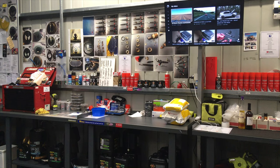Someone's sharing PID codes, okay? So that's good. I've done that also on Facebook and here and there. You've got to find those videos or those posts. But if you look in the comments, you'll see someone sharing those PIDs. They're the codes that you can put into a scan tool. The one here is the soot load, which I previously shared. The torque converter lockup also, and we've got some other ones as well, guys. It's just a matter of following all information. And I think here on YouTube, on both the channels, being subscribed is the best way to do it.